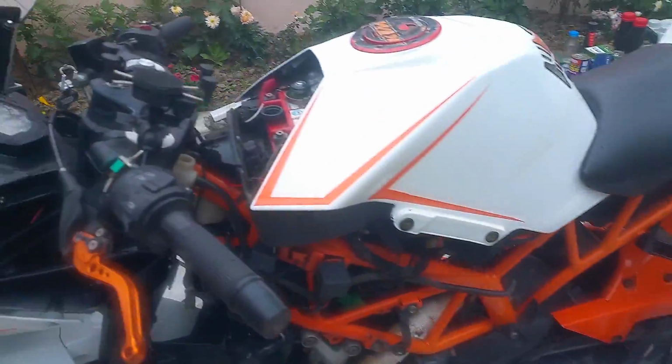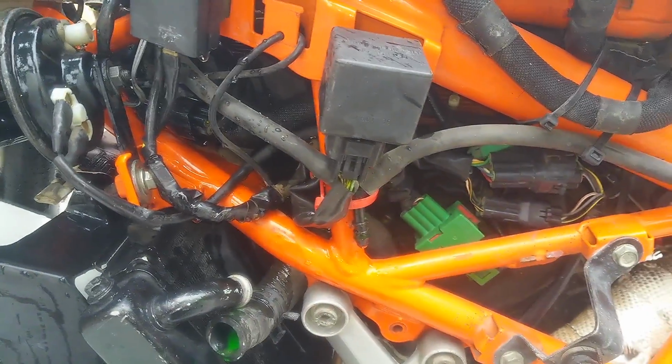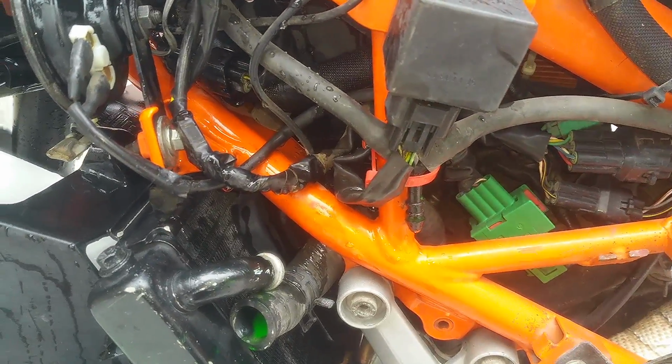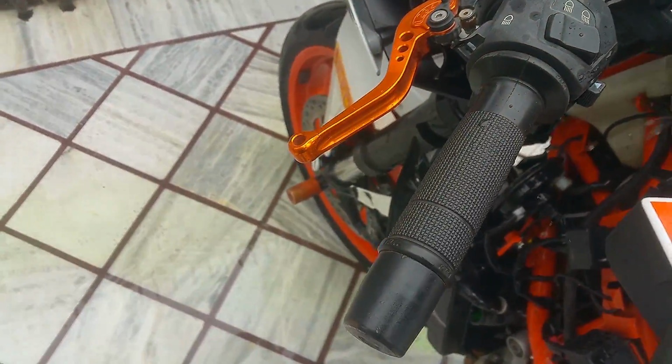So first of all, you're gonna grab a running water pipe, and we're gonna put it over here. I'm gonna show you in a minute. Running water, we're gonna put it inside the reservoir, but before you do that, make sure to disconnect this overflow pipe from the fuel tank. Right over there, we don't want any water getting inside the fuel tank, because this is an overflow pipe. It's gonna come out of this end as well. So now we're gonna put this pipe inside the reservoir.